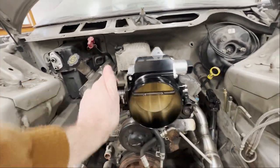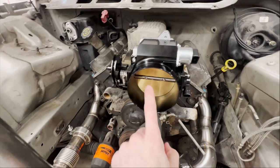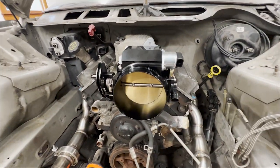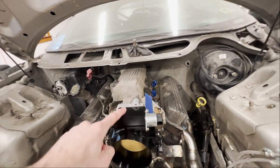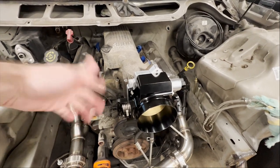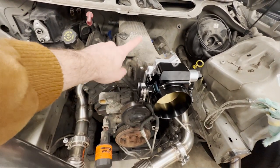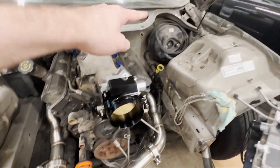There's the finished throttle body and adapter — got everything good to go. I got my seal installed, just had to push that in. Got everything deburred, and got the TPS and the idle air control motor in there. Really the only thing left to do is cut some gaskets when I'm ready to fire this thing up for the first time. I'll also need to figure out something for the throttle body cable bracket and the cable, since this was drive-by-wire and I'll have to figure that out. That's it on the next project. If you like what you see, be sure to hit that subscribe button, give me a like, shoot me a comment — what you want to see, what you like, what you don't like. And we'll see you later.